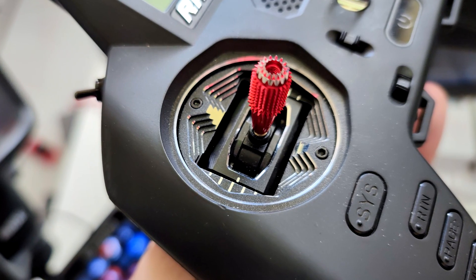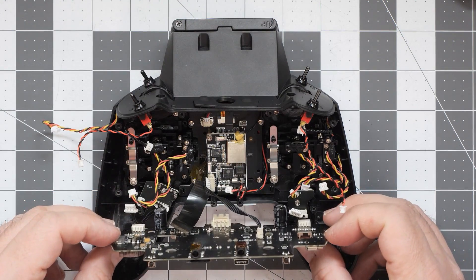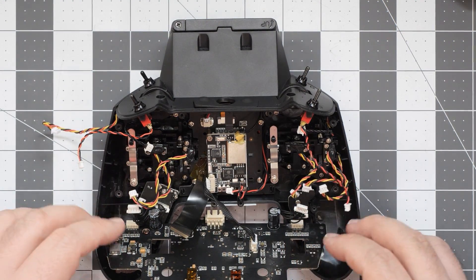However, they are not as good as the full-size AG-01. Not all of the adjustments are available from the top of the gimbal — from the top, you can only change the up and down travel limit. If you want to change the spring tension or set up the centering, you have to do it from the bottom of the gimbal, which means you have to disassemble the radio. The Zorro has some adjustment screws, but those screws are not hitting the contact surfaces on the gimbal, so you can turn them but nothing changes. So if you want to adjust the tension of the springs, you have to open the radio and disassemble everything — and this is a major pain.